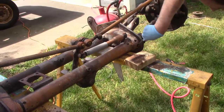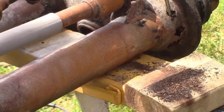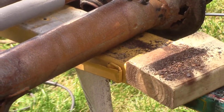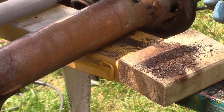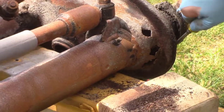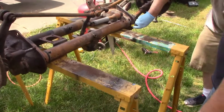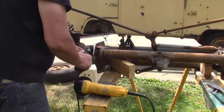Next, we noticed rust holes in the areas around the lower beam, so we're digging that out to see how much rust there is and trying to clean it all out. We end up cutting that rust out, and I was talking to Brian about whether we need to weld in new patches. Because it's just on the outer skin of the axle beam — the actual axle goes through that — it's not really structural. So what we'll do is cut out those holes, clean it all up, blast it out inside, and just POR-15 all that.